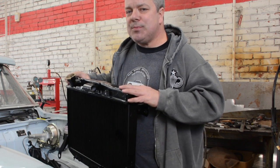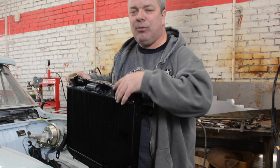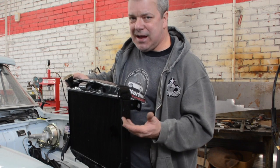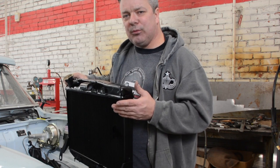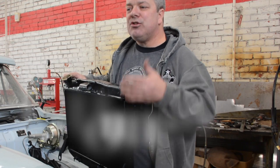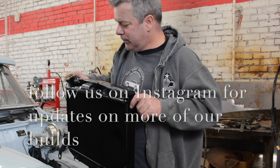The whole point of radiators being painted this particular black, and it's called a radiator paint, is to help transfer or remove heat from the coolant within. The shinier the surface, the less transference is happening. So that's just something to think about, especially if you're considering buying a new radiator. It can't be dimensionally the same as what's going in. It has to have a larger cooling capacity to just match what a proper brass radiator will do.